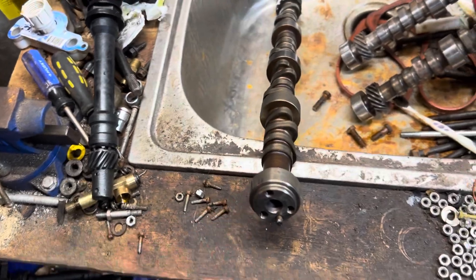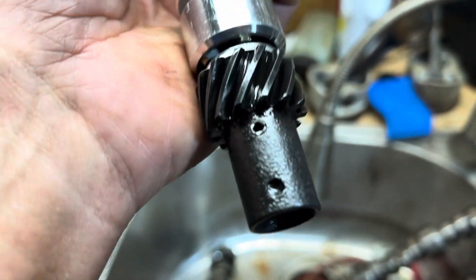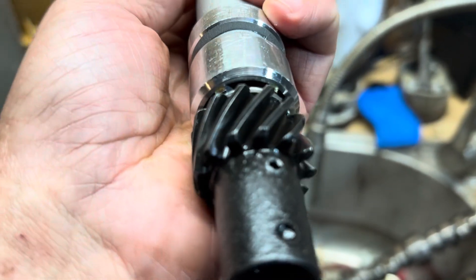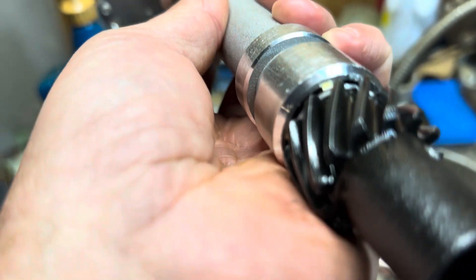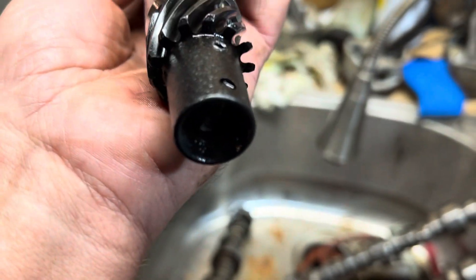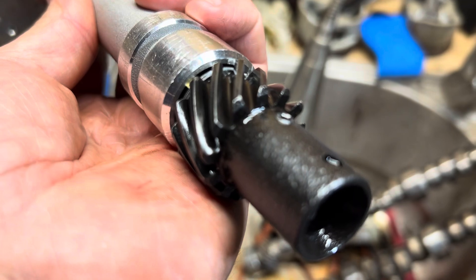I'll provide the melonized gear. Like I said, this gear and that cam went together. Here's another melonized gear — I just bought this one recently. See the wear, the texture of the gear on there. I bought this and ran it inside an engine for less than an hour, and you can see the wear pattern is very, very slight — very smooth, not hardly any wear at all.